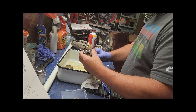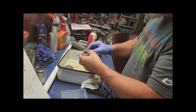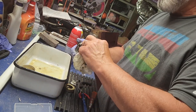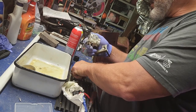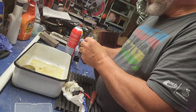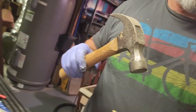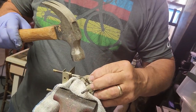What can we do — let's get that Welch valve out, I need to look that up. Welch valve — tell you what. I found out how to get the Welch plug out. Welch plug — Welch, like Welch's grape. I'm finally going to get some of this gunk off — I'm going to use a razor blade on this old gasket. It's dirty. Don't want to scratch the metal though. Let's turn this guy like that and give it some hammer.